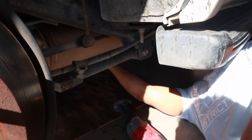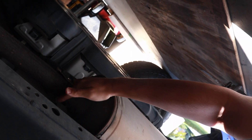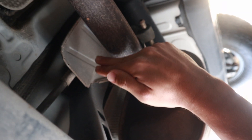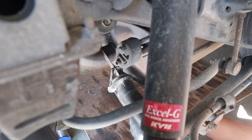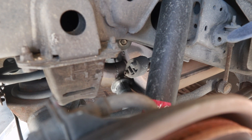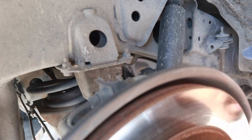First cut — this is a fat muffler. We're going to make a cut right there because as you can see it just turns right after the muffler, and then it's pretty straight on the front side. I want to cut it right here, but I have this plate in the way. Right here is perfectly level with the back half, so I'll end up just slicing it right here. Done is done, ain't no going back now — pretty good cut.